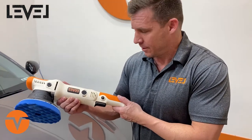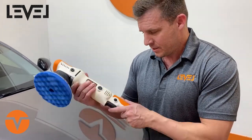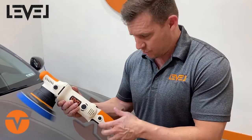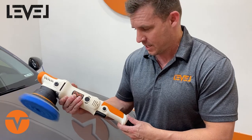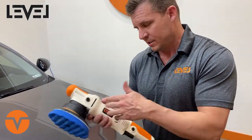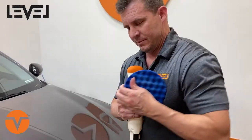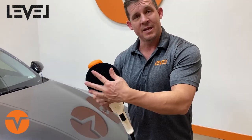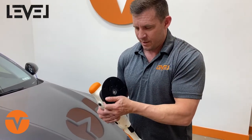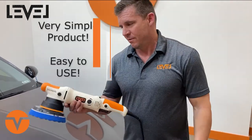We're going to do a quick walkthrough of the DA Leveler. Right here is the speed and power adjustment — one being the lowest, six being the highest. Your trigger turns it on, and then you have an automatic lock button that clicks and engages it so you don't have to hold the trigger the whole time. Right here are your two brush applications — eventually the brushes wear out, you'll notice it by misfiring. Just turn it over, they pop out, lock them back in, screw it in, and you're ready to go. Your backing plate has air holes so heat vents through the machine. It's easy with an Allen wrench to unscrew it — hold the backing plate down and unscrew it. If it needs replacing, hook and loop, line up the center. Very simple, easy to use.